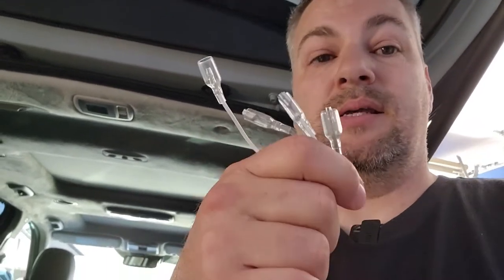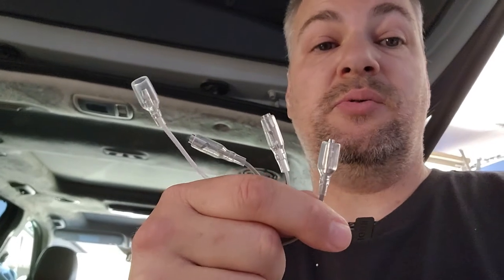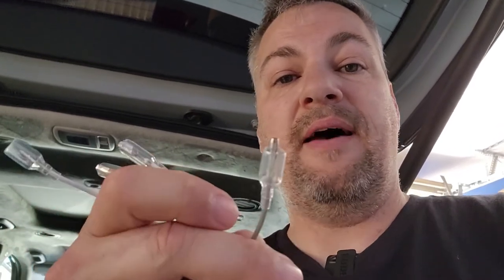So you have this device here. You have your two RCAs, and then you have all of these connections. If you actually read them, it is basically to attach to your speaker wire. So figure your rear signal of your car — it's going to take left positive, negative, and right positive, negative. Now, on the Telluride I could do that — I could do left and right — but it already has a subwoofer.